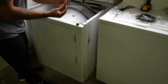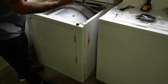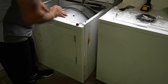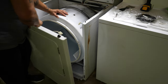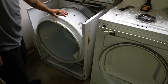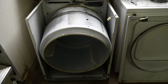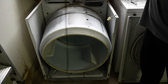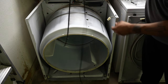What I've done is removed the two little clips that the screws go into on both sides — went ahead and took those off, put those in my container. Now I'm going to push back on the drum and pull up on this because there are two little hooks down here that hold the faceplate in on the bottom. Push on the drum, lift on the face, and voila — we have removed it. You can just let your drum kind of hang there. Here we have it, the moment of truth: is it a broken belt or is it not? Broken belt indeed. That's why we have no spin.